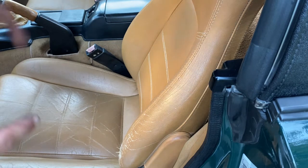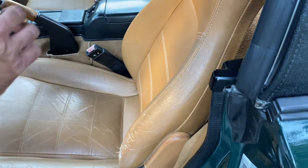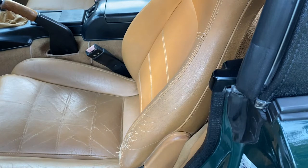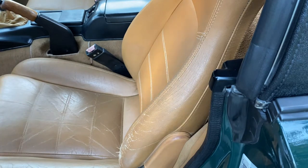You can put the passenger side receptacle on the driver side and it will work just fine. The only difference is it doesn't have the wire that triggers the light if you don't have your seat belt plugged in. If you use the passenger side one, that warning light won't come on, but it'll be fine otherwise.